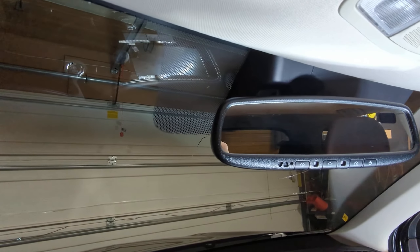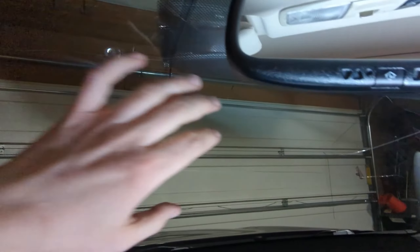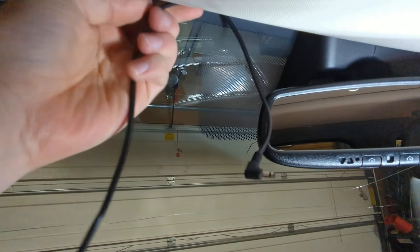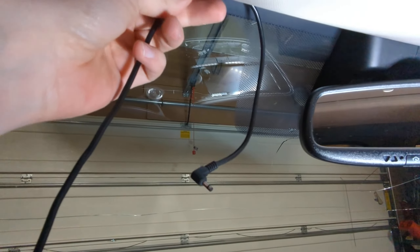The best way to go about this now is to have a good idea of where your dash cam is going to live. My dash cam is going to live maybe right in this area — I'll need about that much slack left in the cord so I can plug it in comfortably. Knowing that, I'll start here and tuck this under the trim, working my way back towards the fuse box. If there's any excess slack, I can put it in the bundle I'm going to zip tie so it's not dangling.